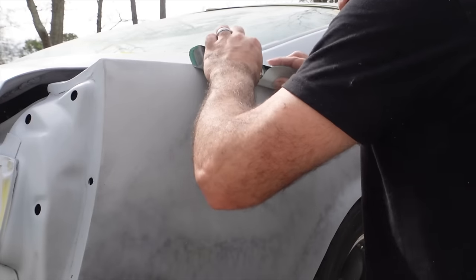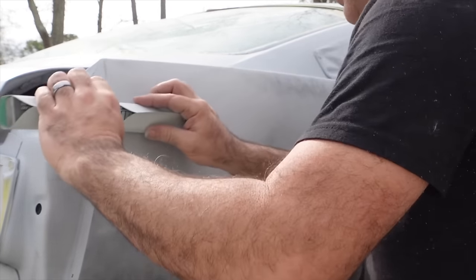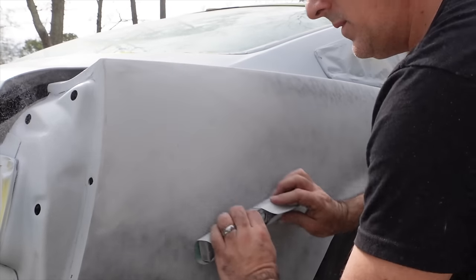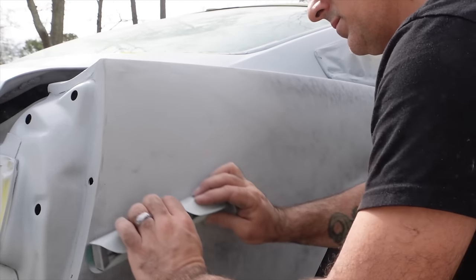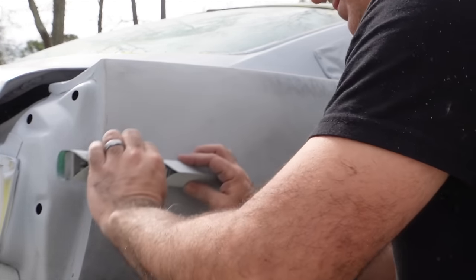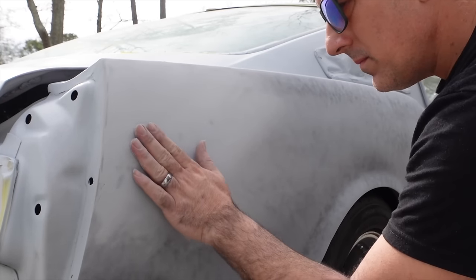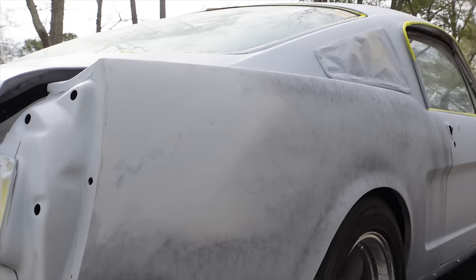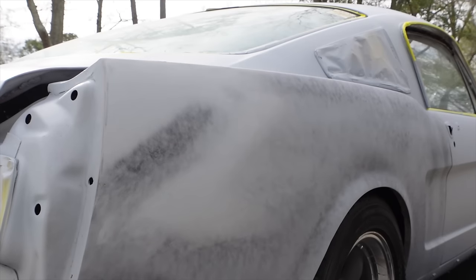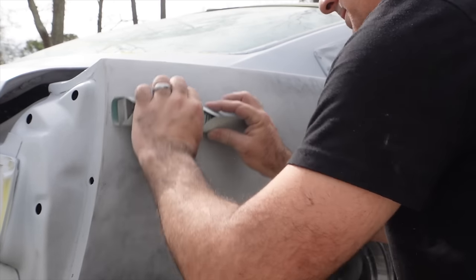I'm using an X pattern, but realistically if this was my last coat of primer I would not use such a small pattern. When you're working on something you know you'll have to reprime and do a final block, you can do this — I'm just trying to see where our low spots and high spots are and if they'll come out. What you're seeing where I'm rubbing my hand across is actually just the difference in primers. I come back with a little bit of guide coat to check it — you want to see all the guide coat come off.